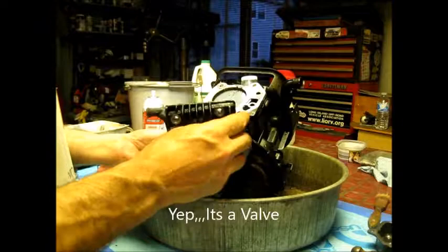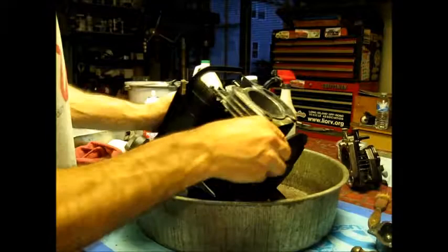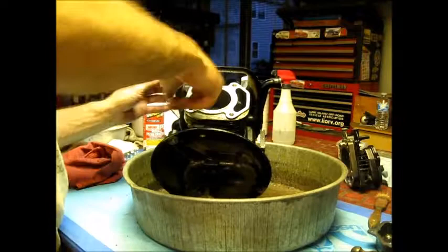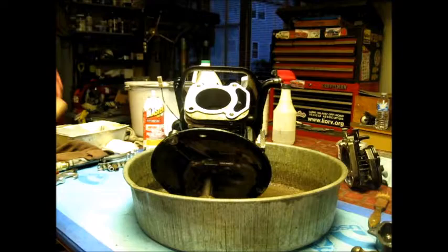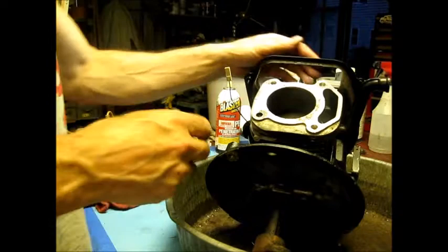So we need a gasket. The shop around the corner might have it, but I have to see if I want to put in anything else. There's a little bit of a score in here — it picked up some debris right here and a little bit right here. I can feel it; it's not that bad. It could just be junk, or cylinder distortion. What you want to do now is take off the rest of it.